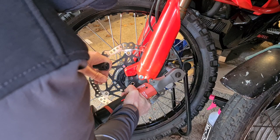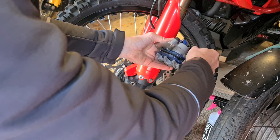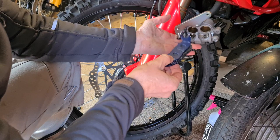I thought those would be a lot tighter - there we go, and we're free. With the pin out you can release the pads. If you've done a bit of miles you might be looking at pushing those back for the moment. There's a little bit of wear on the pin. Once cleaning up - I have already cleaned that, committed the YouTube crime. Pads and back plate.